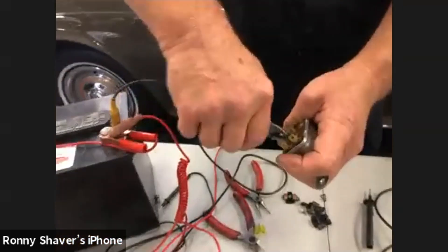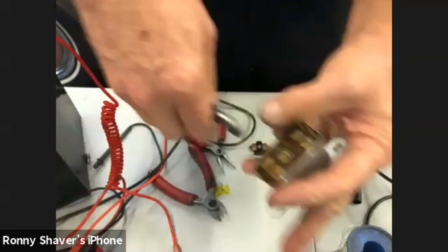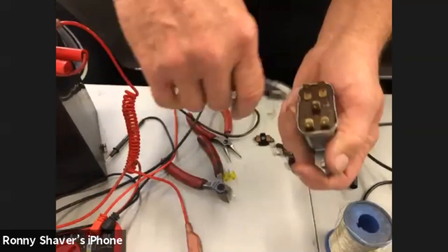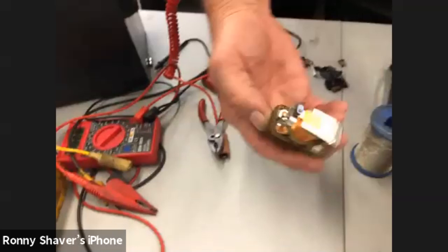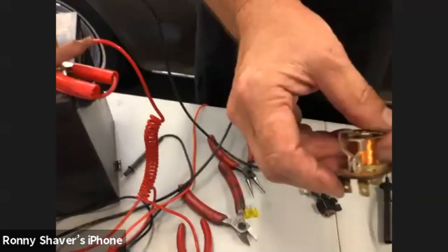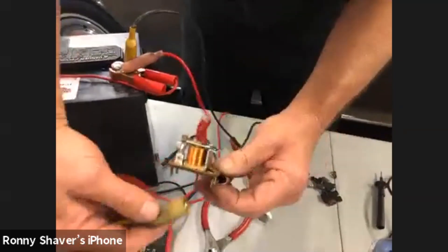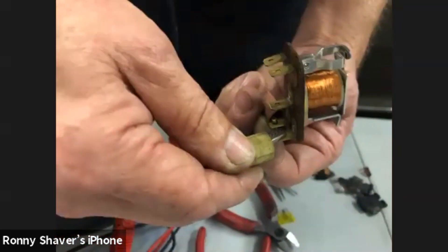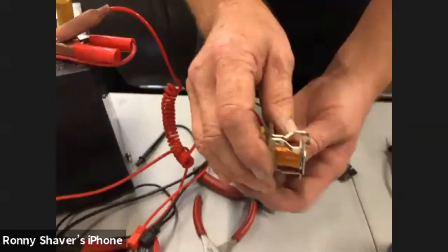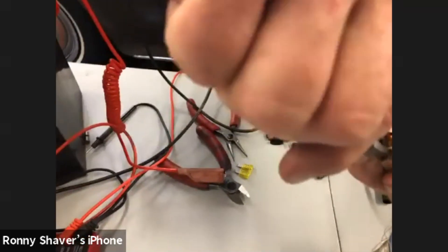That's the nice thing about these Prince of Darkness relays — you can take a pair of pliers and pull them open. This is like open heart surgery. There is a relay. What you'll see is this is the electromagnet. We're going to activate it and show how it works. These are the normally closed contacts. As soon as you activate it, it closes and it's supposed to activate the normally open contact. A lot of times the contacts get dirty, and a lot of times heat will bend them — it looked like it wasn't quite touching, so we'll bend it up a bit.